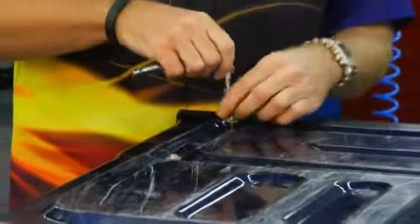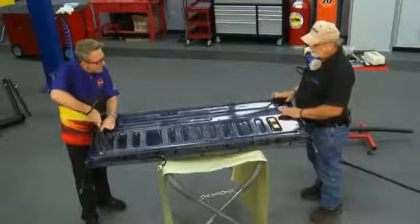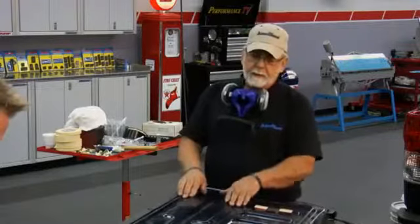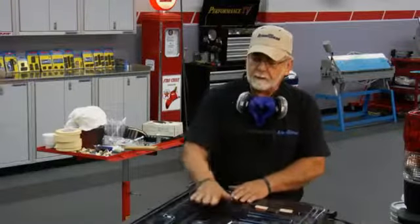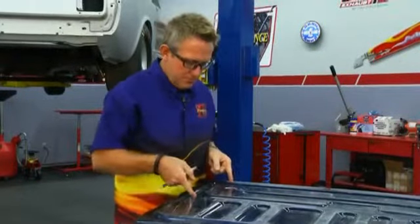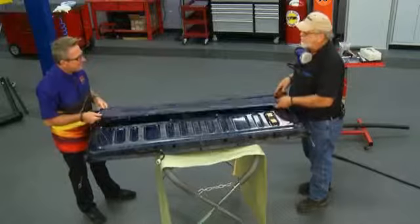All right, we got our tailgate off, and we're ready to tape it off, but we're going to remove this panel, Jack. Now, why are we removing this panel? Well, if we left the panel in place and sprayed the tailgate with ArmorThane, we would seal this panel to the tailgate, and unfortunately mechanical parts have a way of breaking. You couldn't get in there to get them out.